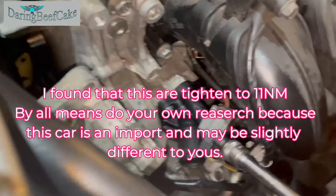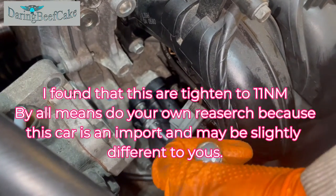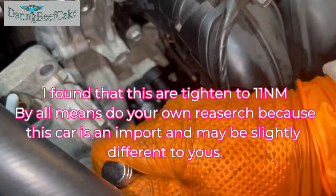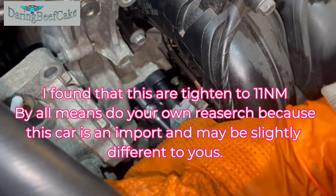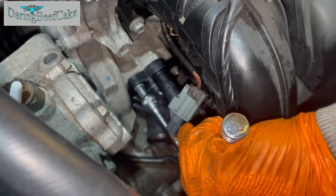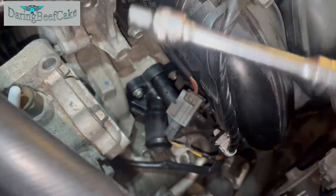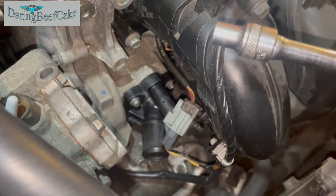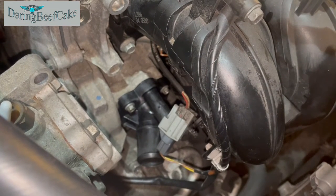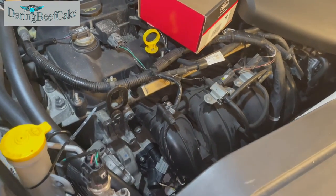So I finished tightening all the bolts, and like I said, once you feel they are close, you can turn them a little bit more, maybe an extra few millimeters on your ratchet. So I can't do it with one hand. But you really need to be careful you don't break them, or you will spend another 3 hours taking them out again. And worse, if the actual head gets damaged there.